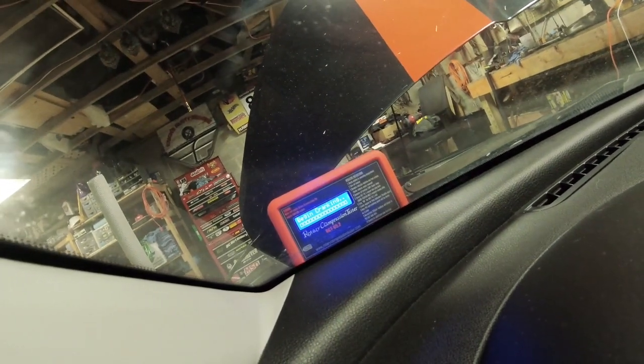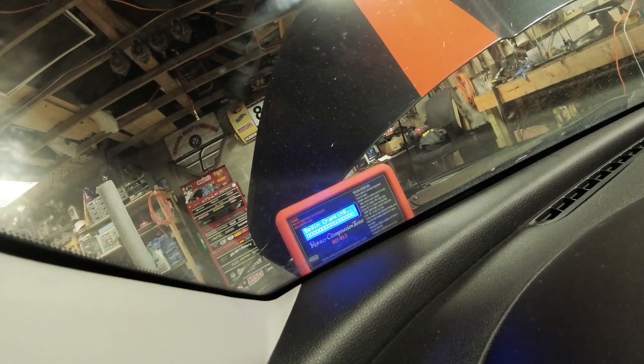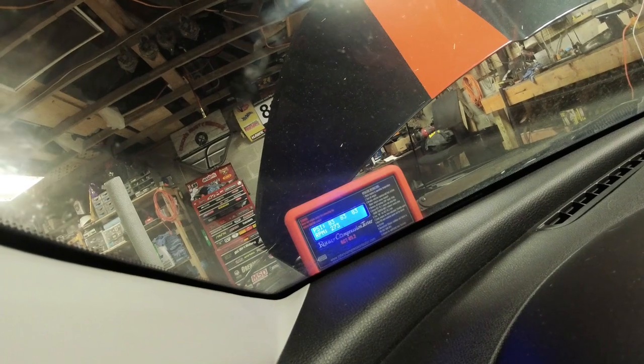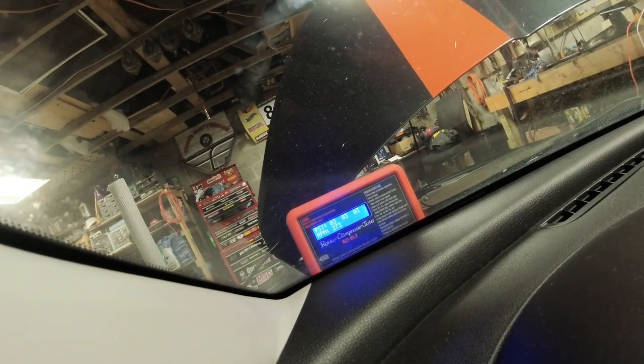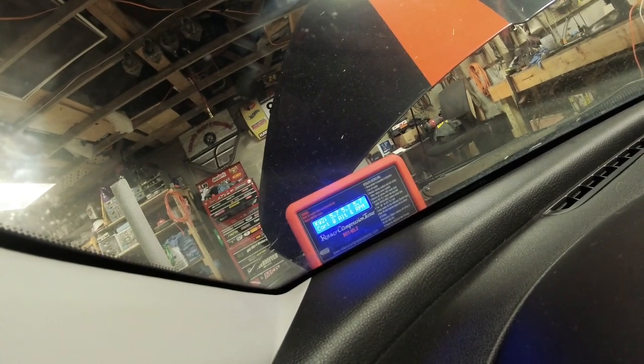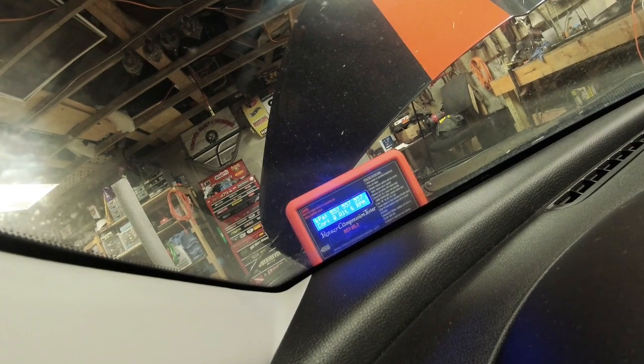Okay. Hot compression. Rear rotor, how ruined is it really? Take your best guess, I'm saying 77. Oh, 83 across the board, 81. Not that bad, but definitely lower than it was cold.